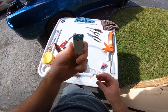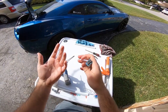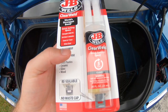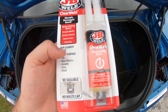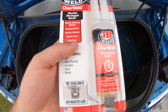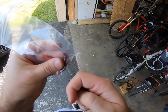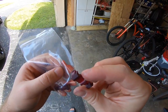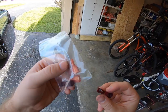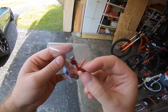Here's a battery — we're actually going to use it to test the lights before final installation, because you don't want to install the lights, glue everything back on, and then realize the lights are defective from the factory. You'll also need an epoxy; once you've opened the tail light you're going to put some little dots where the tape would go as a better way of bonding. Also included in the kit is a little baggie with T-connectors and butt connectors — make sure they are red, not blue, as stores typically only carry blue ones.